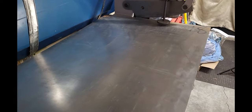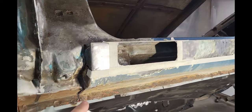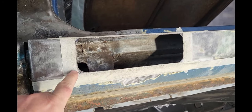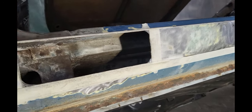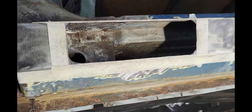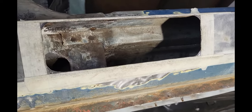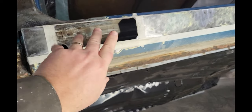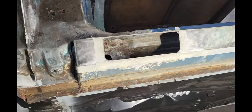I only screwed that up a little bit — a little off the line — but it certainly worked all right. It's fast, faster than tin snips, but that's okay. It's just a patch piece. I taped up the area that I wanted to cut out and patch in here, then came around and cut that out just above this body line and just below this upper body line, so that I'm not welding right on the body lines. I also made the corners rounded so that I don't have square corners on my patch piece. I'll tape this up and use that as a template to transfer onto my piece of steel and cut it out so it fits right in the hole.